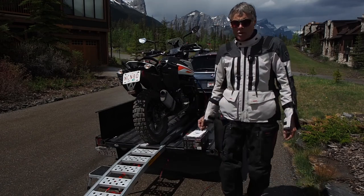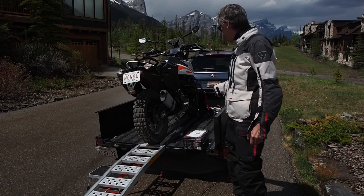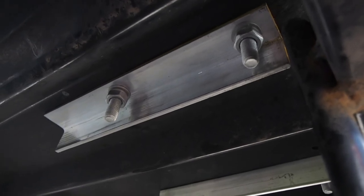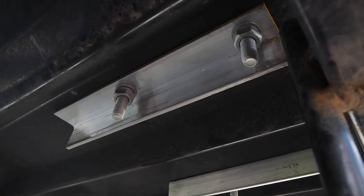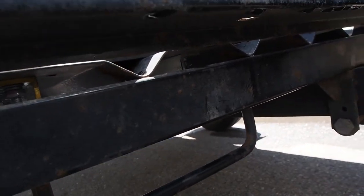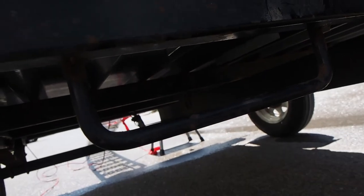The only thing left I want to show you is what I did to the trailer to make the mounting point strong enough that I wouldn't be pulling up the floor. We're looking at the underside of my trailer now. What I did to make the bed of the trailer stronger is I used two pieces of one-and-a-half by one-and-a-half inch, quarter-inch thick angle iron, and I bolted right through from the bolts on the winch through the trailer bed down to that. The trailer has a welded bed, and for my tie-in points, I've never had any issue with bending or deflection.